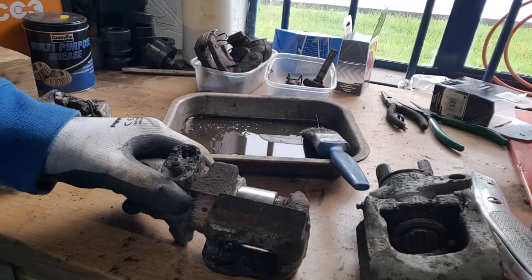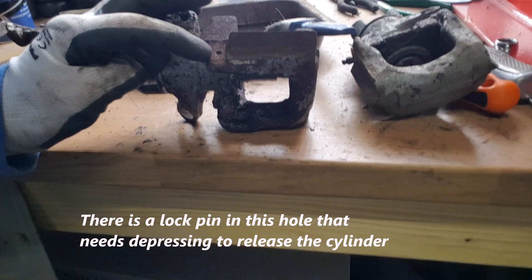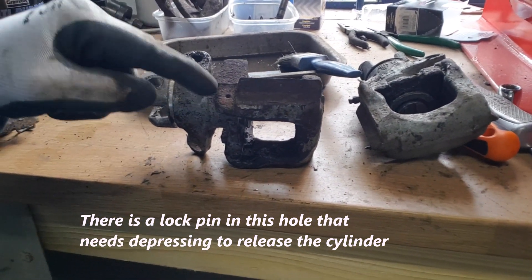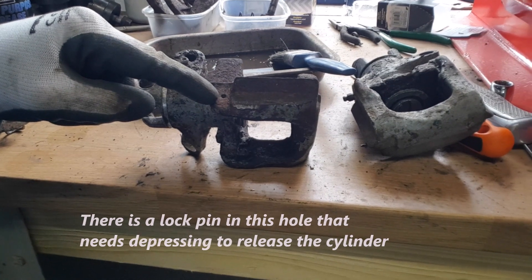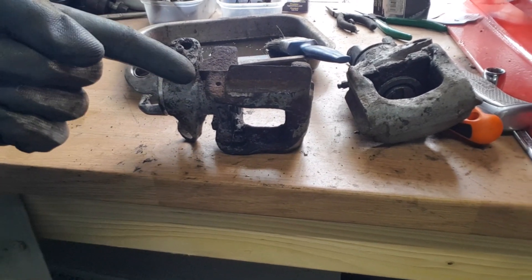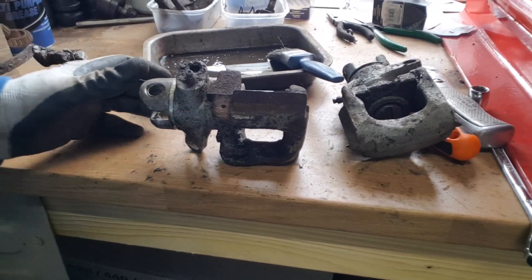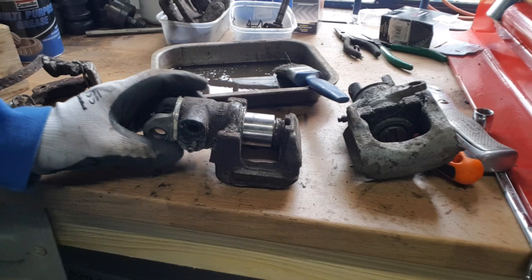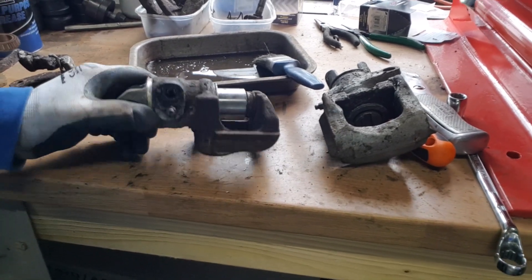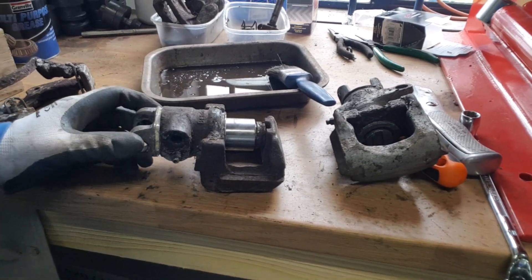There's a little hole in the side of them which stops the whole thing from falling apart, but it's a real bit of Mickey Mouse engineering I think. So what we're probably going to end up doing is drilling that out and putting a little grub screw in there — and thanks to the guys off the Lancia Owners Club, Matt Tambini sent me some very useful information on that, so thanks Matt for that.